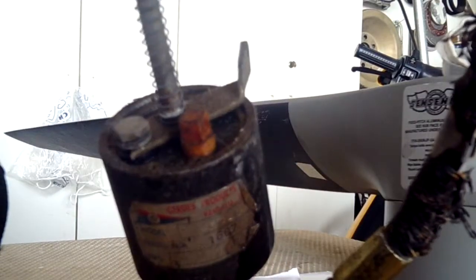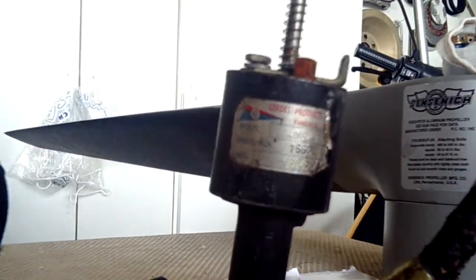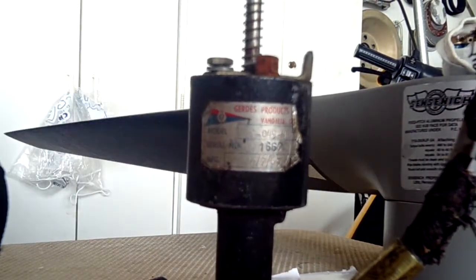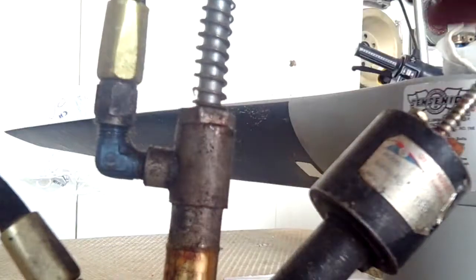There's a little cap on the top where you can add and check your fluid. This is for your parking brake, and you only add fluid to the two master cylinders for the left and the right system on the pilot side. The co-pilot side is called a slave, and the fluid just goes through it.